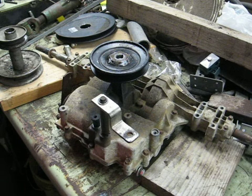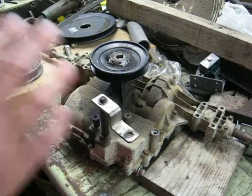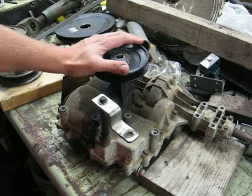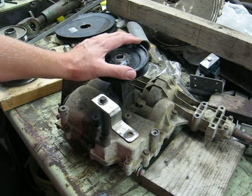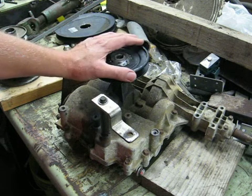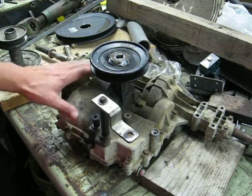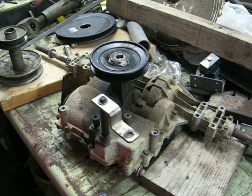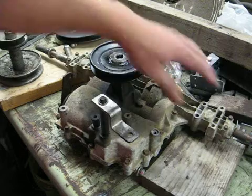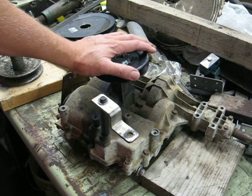You want it to go a little faster because in original form it's going to go 5, 6, 7 miles an hour. The real rough general rule of thumb is that if you take the stock transmission and give it a 1-to-1 pulley ratio — meaning the transmission pulley is the same size as the one on the engine — you're going to get, at an engine RPM of around 3600-3800, between 15 and 20 miles an hour top speed on the road in high gear. I misspoke in my previous video — I said these transmissions had an overall ratio in high gear of 7-to-1, and I was incorrect. It is 7 turns with one axle stopped; the differential turns the other one twice as fast, which equals a 14-to-1 ratio. MST transmissions — as far as I know, every one of them, whether 5-speed or 6-speed — have a 14-to-1 high gear ratio.